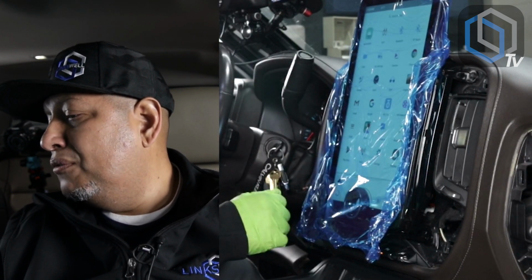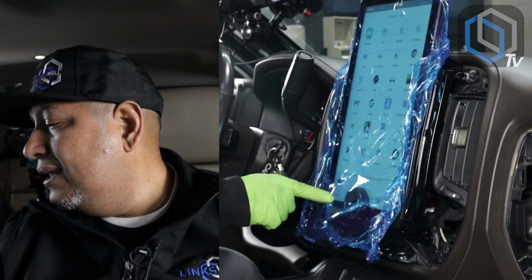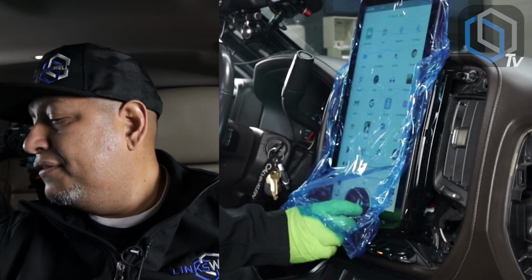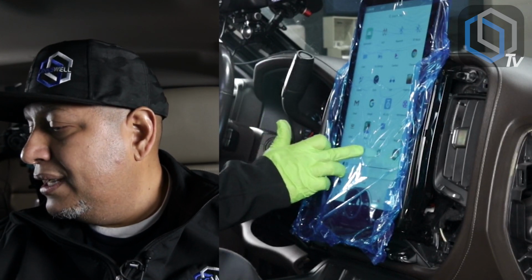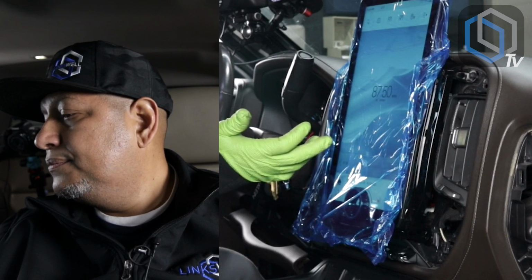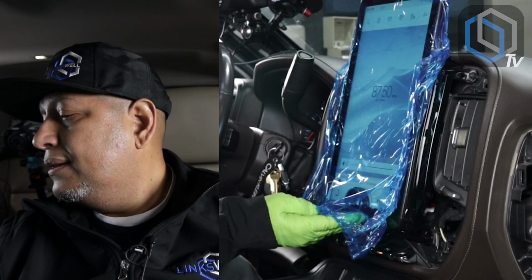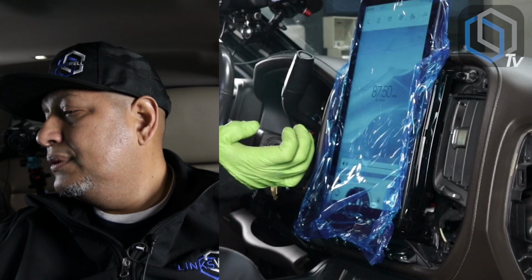The first thing I like to do is go to radio. So swipe up from the home screen. I see radio and I'm at volume 10. Just in case that's too loud, I'm going to turn it down to like 5. Then I'm going to go to radio because I want to hear some static already. So now radio is up and running. I have static. Let me turn the volume up. Okay, that means my Bose retention module is good and I'm getting audio.